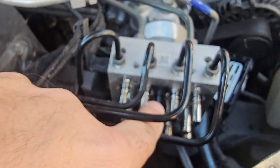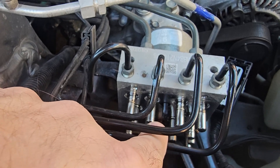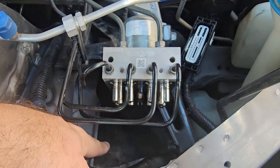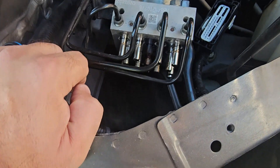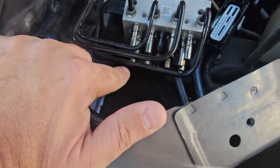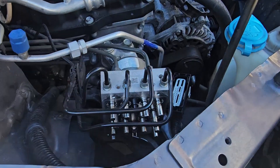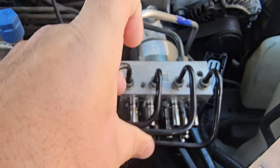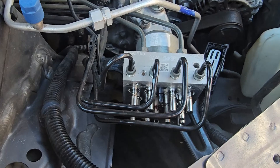This little black piece in the middle has prongs that come off with the module itself. To get to the two screws on the bottom, use the fender well — you can get to them from the back side. Take off your passenger side wheel, pull the clips off, pull it down from inside, and you can access those screws. Pop the module off. This whole piece moves back and forth so you can get a little room without pulling your brake lines off.